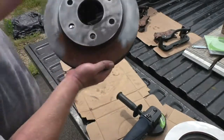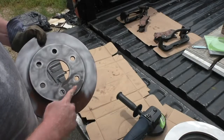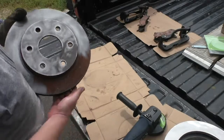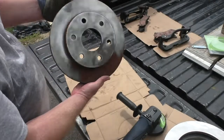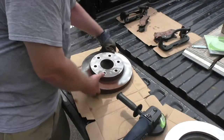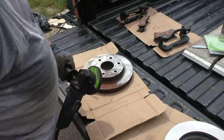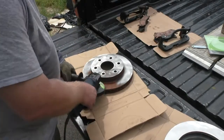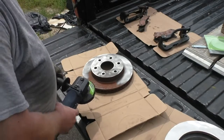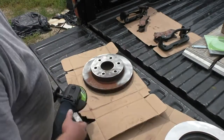I've just been going at this rotor. I've got the top here. Didn't get this so much yet, just the first pass. I've gotten around the outside here, but not quite down here yet. It does a decent job — really not bad. The key just seems to be set it in lightly, let the wheel do the work and tip it a little bit. You're taking off the rust you want, and keep it in motion. Don't let it sit anywhere otherwise it's just going to grind in.